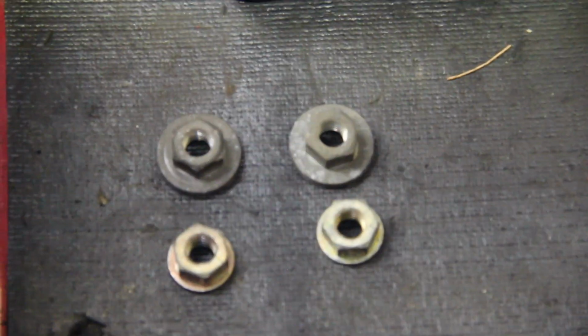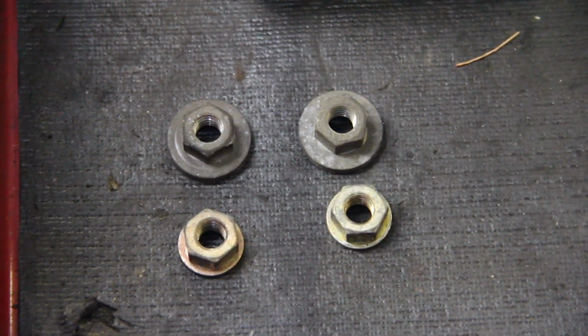And I didn't use too much of the wobble, but the ratcheting part saved me a ton of time on both upper nuts, and the upper nuts are different than the lower nuts. They have a large separate flange on the bottom. The flange is attached, but the nuts spin independently from the flange. So that's what the top nuts look like.